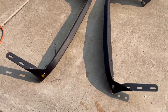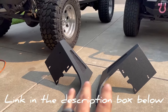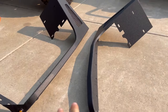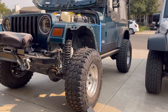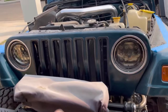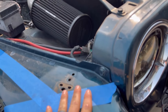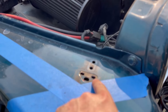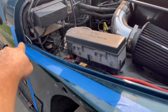These are the fenders — I really like these a lot. I found them on Amazon. We basically have to make some modifications to the existing fenders for these to bolt up to the body or the tub. I'm walking through what I've already done so far. We're at the point where we need to start cutting, and I've masked off all the areas we're going to cut. I'll cut on the inside of this tape and come all the way along down to the end.